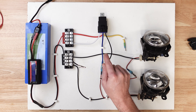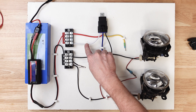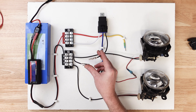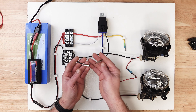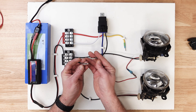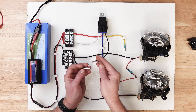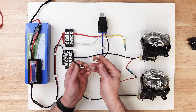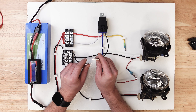I'm going to use this relay to switch these lights on and off. The relay itself, as I pointed out in the wiring diagram, is triggered by the power lead (the white wire) and the black lead (the grounding wire). In this configuration I'm ground-switching the relay — my switch is on the ground side. You could just as easily put a switch on the power side and run the grounding wire directly to the grounding distribution block. When I throw the switch and energize the relay, these lights should turn on.